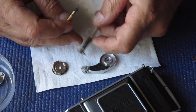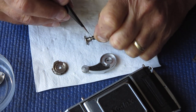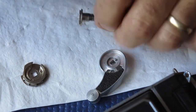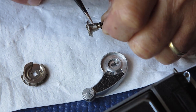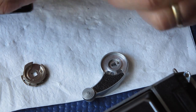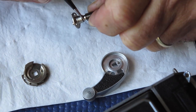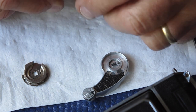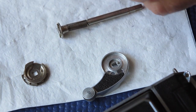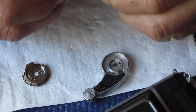Here I have some graphite grease. Now I'm looking at the state of the shaft. At this point where the bottom coil of the spring would sit, that brass shaft has got quite a pronounced groove in it. That suggests to me that the spring has had too much tension on it and this has managed to wear in over time, possibly with the help of a bit of dust to act as an abrasive. I suspect that the tension has been too high — someone has wound up the tension on the return spring too high — so that spring was cutting tight into that shaft.